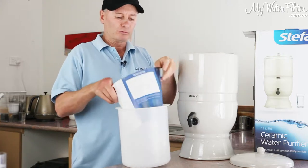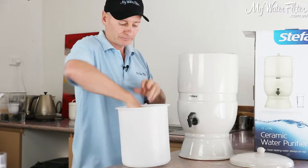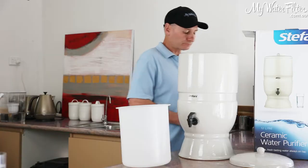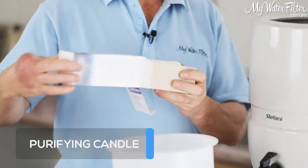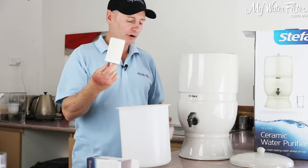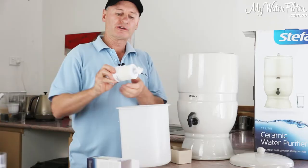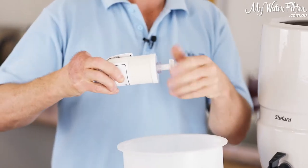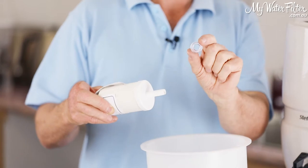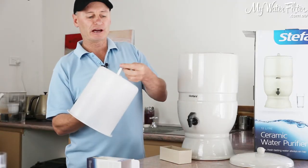Second part, we'll put in the cartridge. Here's some information — a few do's and don'ts, 12 month warranty, things like that. Here's our cartridge, ready to install. Now with these candles, just be aware that we don't want to touch the ceramic part of the candle. So if you haven't got any gloves on, get a piece of paper — anything at all — just wrap something around there so that you're not touching your fingers onto the ceramic part of the cartridge. Off with the nut and the rubber washer. Leave one rubber washer — one O-ring — on there. There's only one hole in the bottom of this tank, so we put the cartridge through.